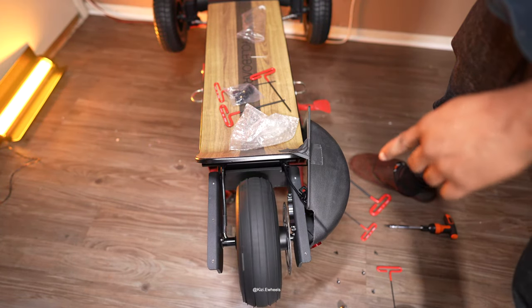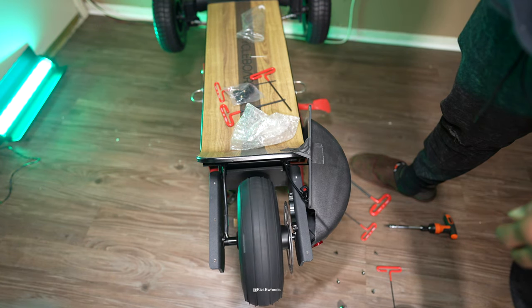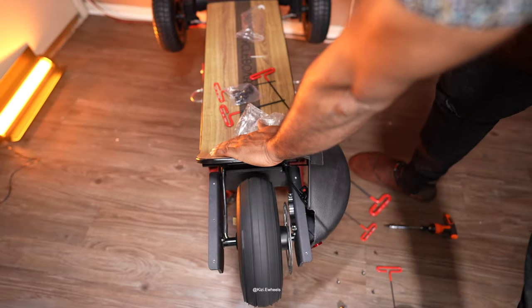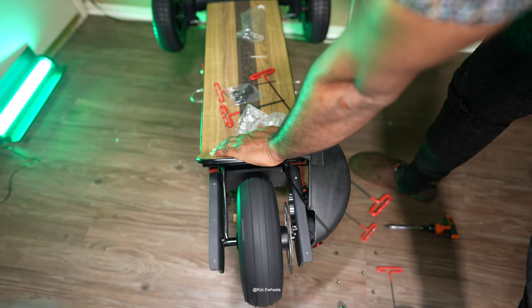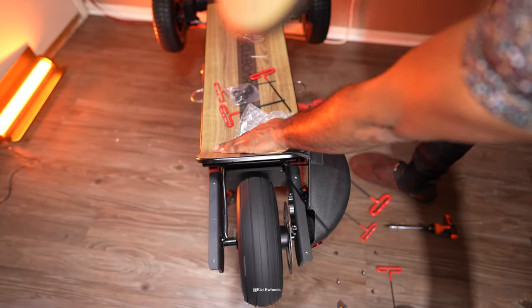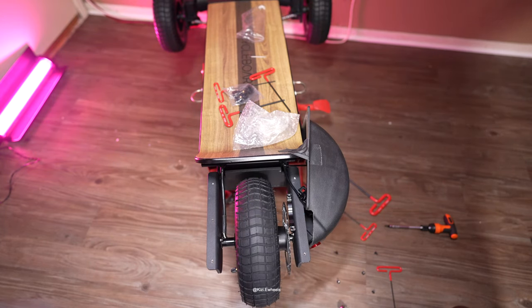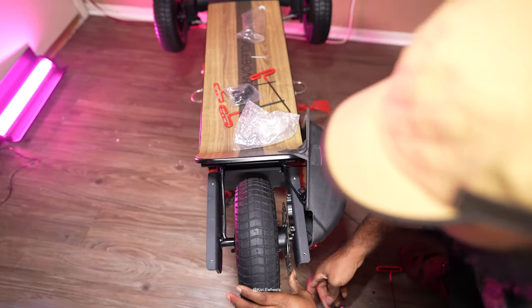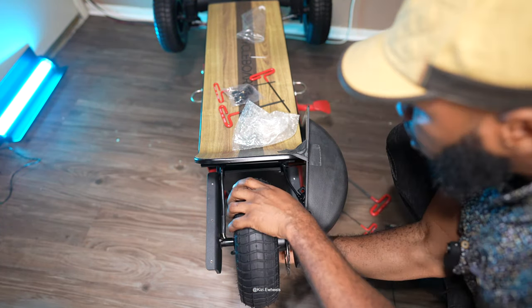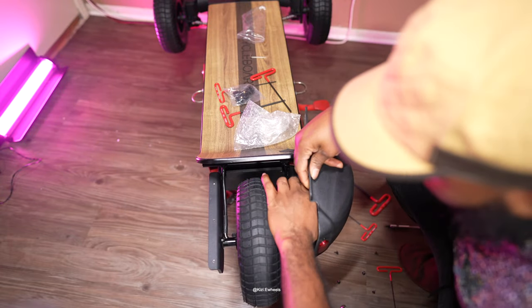That was coming from the brakes not being adjusted properly. So as you can see right now, I'm not hearing anything, it's just the motor. So the noise was coming from the brake, I guess not being put on there properly. I hope that the disc is not bent because I'm looking through it right now. The brake disc, because these things, they're like super fragile for some reason, and they easily get bent. But I'm gonna attach this back and line it up properly.